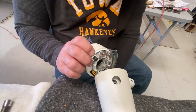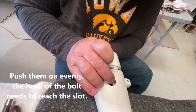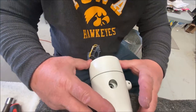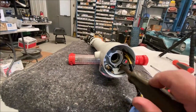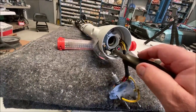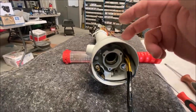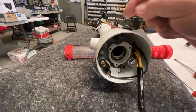They fall out like that and you try to push them on at the same time — this is a pain in the ass. There we go, I got it. You can see by the gap that I got it — they're pushed back in place. Then take your 7/16th nut driver and tighten them. They're getting there. That's how this hub goes on. I got that plastic thrust washer in between this hub and that hub, and I greased it.